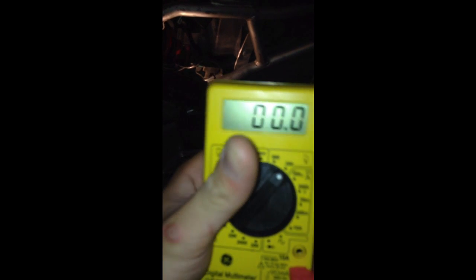What we have right here is a digital multimeter. If we look at the settings — this V with a straight line over it means direct current voltage. Then you also have a V with a squiggly line over it, which means alternating current. So if we're checking the stator it's going to be alternating, because that's the raw voltage that comes and goes to the rectifier and turns into direct. So we're going to set it to alternating and turn it to the lowest setting, which is 200.